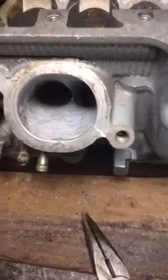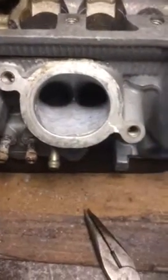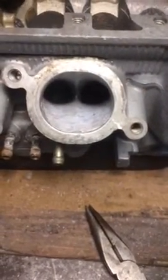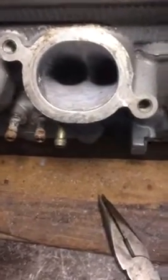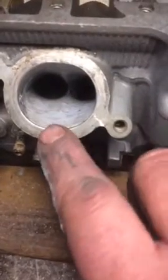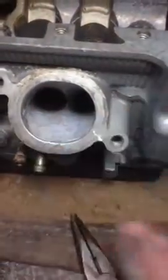I just begin building it up. It wants to go up quite steeply from the carburettor to about 18mm. So your port height is going to be about 18mm right the way through until you get to the turn, which we'll do later on. It wants to come up from the carburettor and then go quite steeply up to 18mm and just keep going that way.